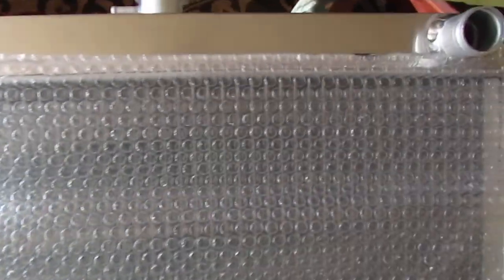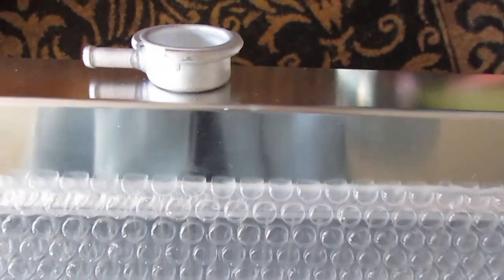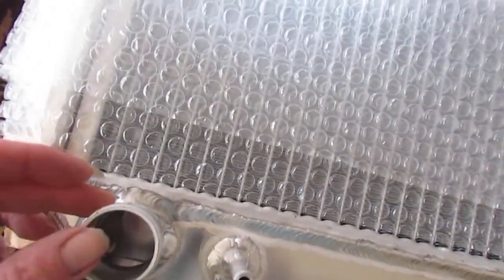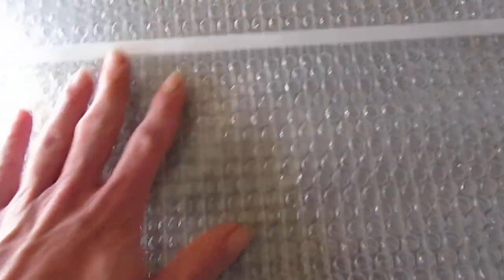Here's the radiator I got. It's aluminum. This is a different size neck than what's on the truck now, so I don't know what I'm going to do for a radiator cap — there's not one in the box. It's also got transmission cooler lines for some reason, so I'll have to cap those off. Comes with a petcock. Looks about the right size hoses. It does have the mounts for the shroud, which is nice. A lot of times aluminum radiators don't have those, because a lot of people put an electric fan on there, but I'm not going to do that.